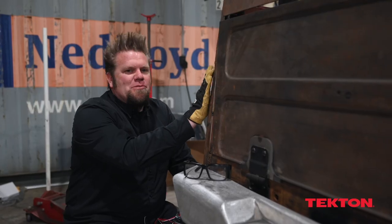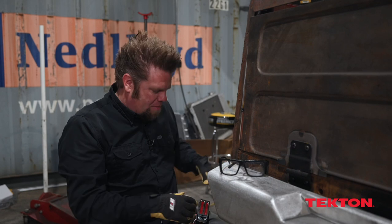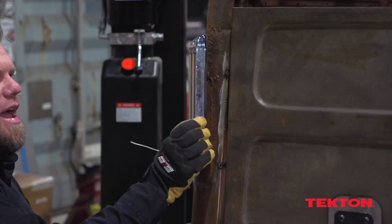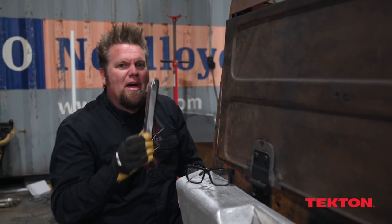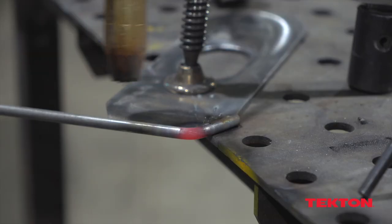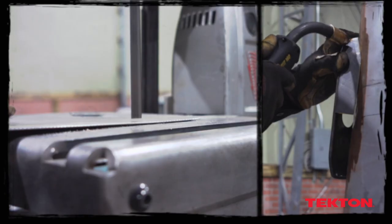From the factory these Willys wagons have a flush mounted tail light with a little chrome bezel, and the previous owner tried to repair some of it. I don't want to run those tail lights - I picked up LED trailer lights online that have a chrome bezel look. I don't want to mount them right to the sheet metal because there's a lot of sheet metal to fix and they'd sit at an angle. So I'll build a little plate, step it off from the body a bit, do a little accent around the edge. The taillight mount will be cut out of eighth-inch plate, then I'll skin and flow it into the back of the wagon with some 18-gauge steel.